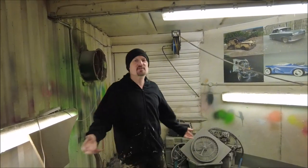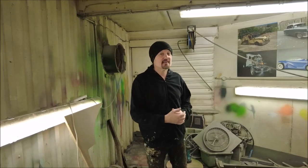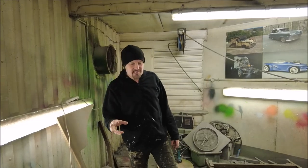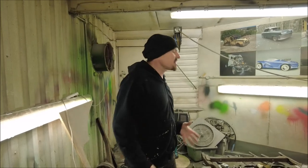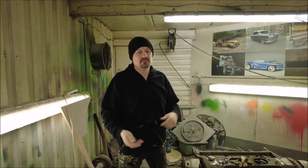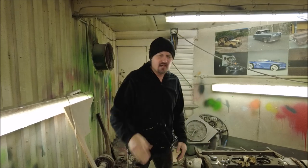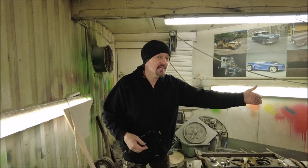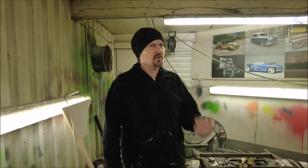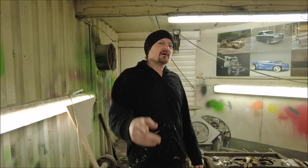It's not a new project - you've seen it before, but we've been doing a bit on the SS Mercedes. People who are new to the channel have not seen the SS Mercedes before - this is how it's going to look. The thing is going to be absolutely amazing, although those wheels are massive and we were having trouble packaging the whole thing. We were trying to keep within the law using the taxi chassis, but we're going to open ourselves up to more testing. We haven't got the freedom within the law with the extra testing beyond the MOT that we need. So we've changed the axles. I've gone for Jag front and rear from a Mark 2 XJ6 - off an XJ6 Coupe actually, one of my favourite cars of all time.